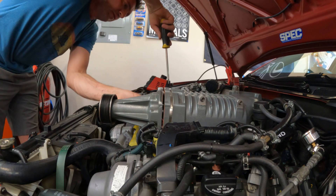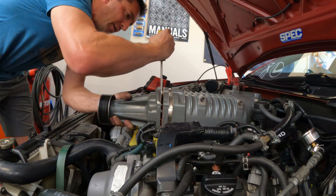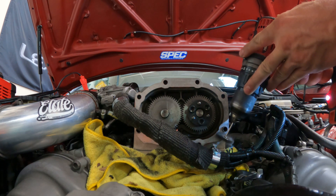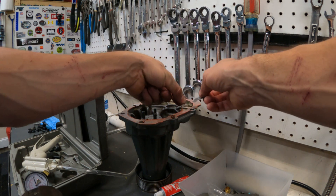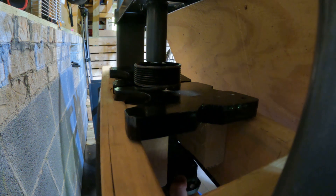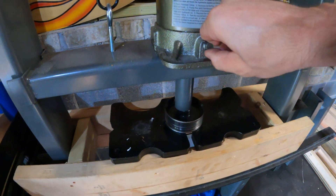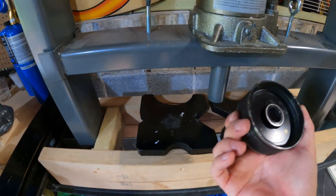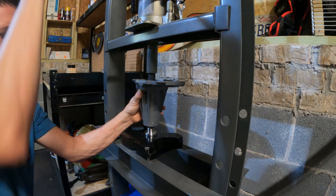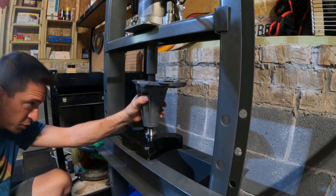You don't want to damage the mating surfaces, so just go down, wiggle, and be real gentle with it — this thing should pull off just like that. You can feel this quite well as you go down. You want it to bottom out, but don't keep going and put too much stress on the shaft.